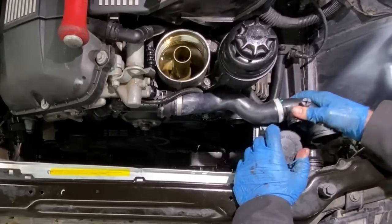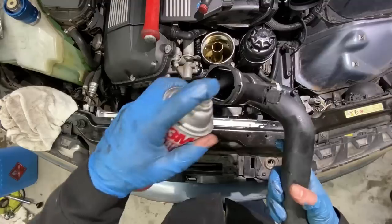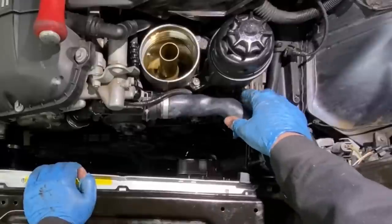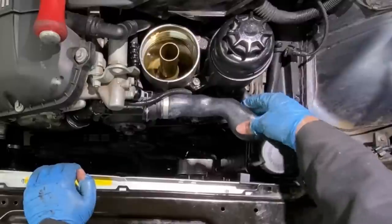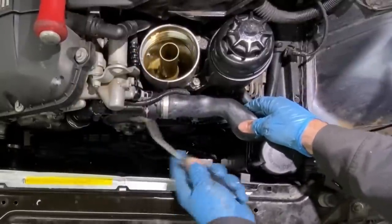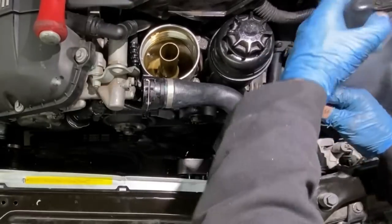That clip nice. This hose ain't so great. It's a little long. I gotta stop for today, guys, because this upper radiator hose, it's too long. It's all bunched up right here, and it's causing the hose to bunch up and be bound right here, and that might even limit cooling ability, so I'm gonna call O'Reilly and see if they can get me another hose coming. I really wanted to get coolant back in this thing today, but it's not gonna happen.